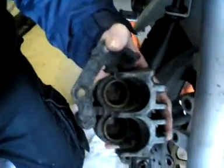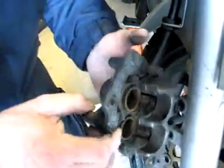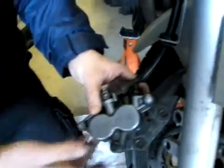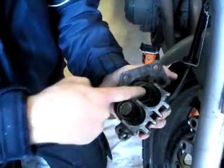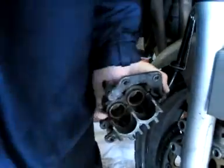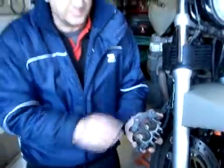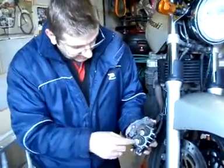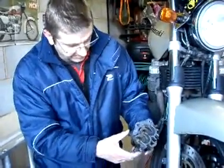So there we have the inside of a brake caliper. This is what we call a twin pot, or a two-cylinder system. Brake fluid comes down here, and when you squeeze the brake handle, it forces brake fluid down here into this chamber, which is actually behind these two pots — these are called the cylinders. So once you've got liquid in behind there, being pushed through by the brake action, it pushes these out. We're going to take the whole thing apart anyway.